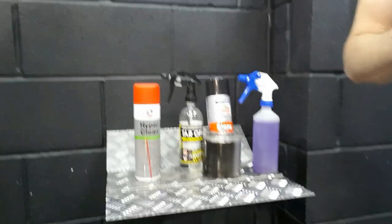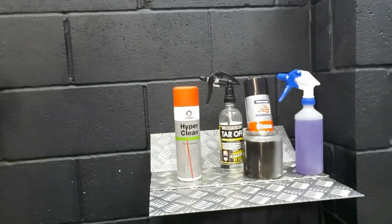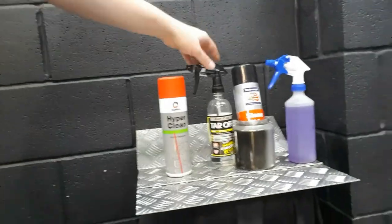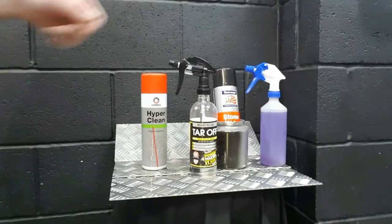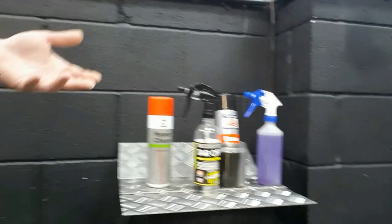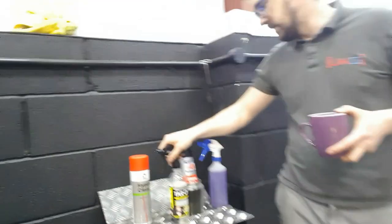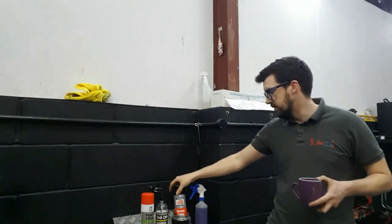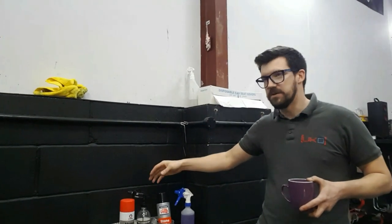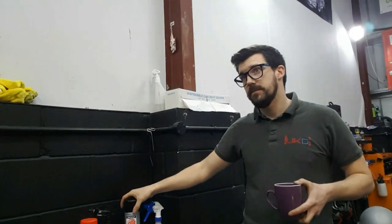It's a rear mid-engine layout — hopefully just like a Ferrari, in so few ways! Then we've got Power Max Tar Off, which is a solvent cleaner and tar remover. I've got that to deal with any tar spots under there, but mostly because we're using stone chip guard next — it'll make it easier to remove any overspray that gets onto the sides when we're spraying it around.